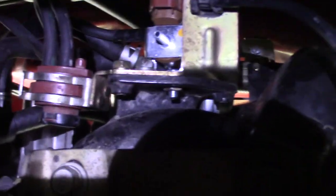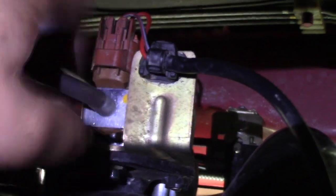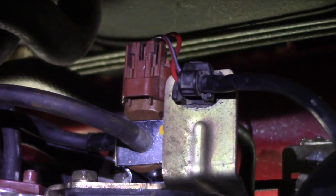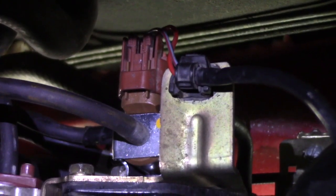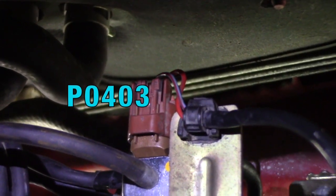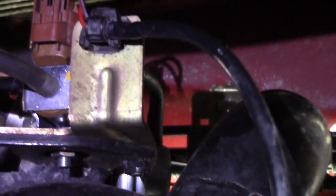Never mind, you're not done — I totally forgot the hose. I have to put on this hose. I think I didn't turn it on or anything because I never detected a vacuum leak, and I don't want another code. So this is an EGR vacuum solenoid. Replacing the solenoid is going to get rid of your P0403. It can also be the EGR valve — could be dirty though, so be aware of that.